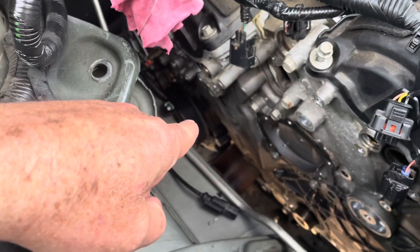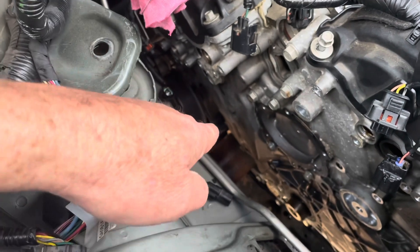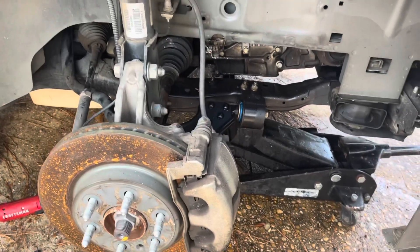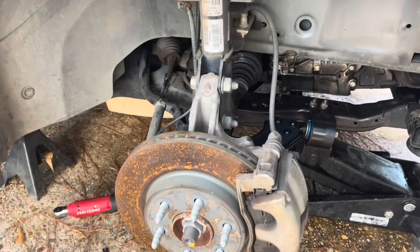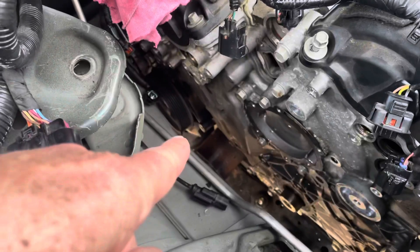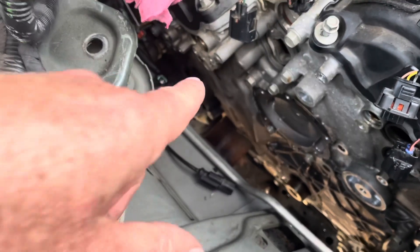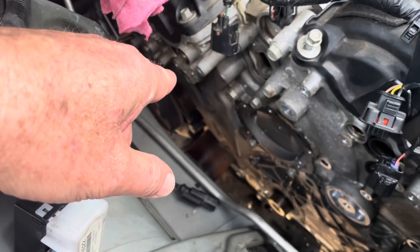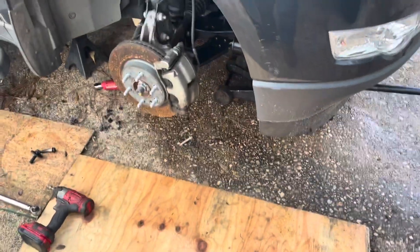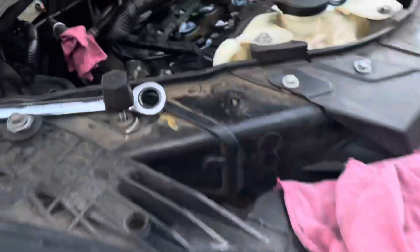One of the gotchas is the power steering pump down there — you have to unbolt it from the block. There's a bolt in the front which is relatively easy to get to. Obviously I had to pull the tire off and pull that fender well cover off also. With the tire off, you can get to most of the lower side of the engine. I had to crawl under this car to get to the back bolt. It's kind of risky because I've got the car supported on jack stands only and also a jack — double protection on this side. On the other side, I've got a jack stand and a wheel underneath just in case.